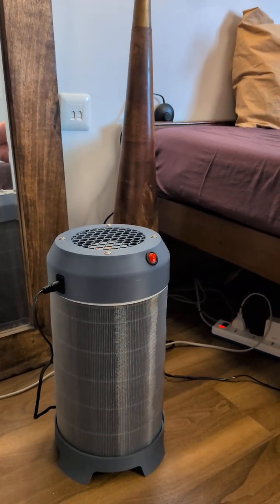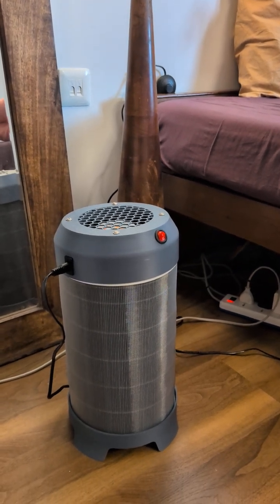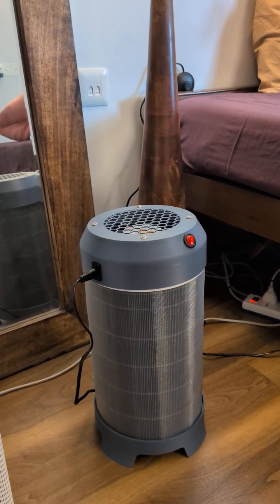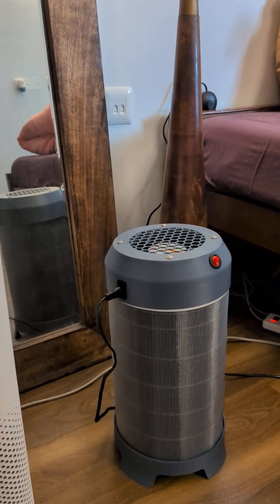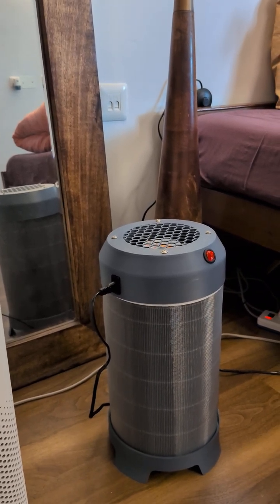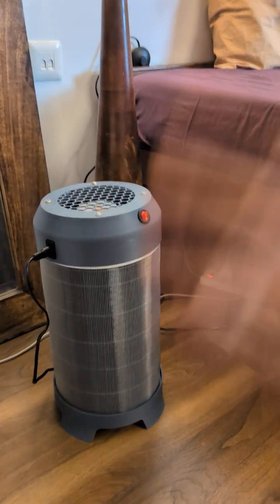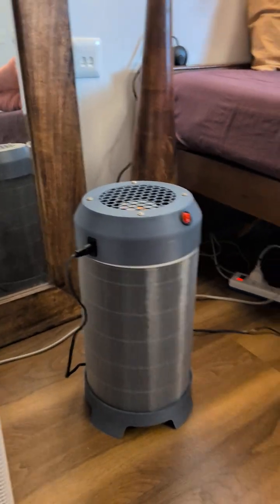I'm testing a DIY air purifier I bought from Jayant on Reddit — I'll add his bio to the link. It has a Xiaomi filter and a 3D printed canopy that helps it stand and look better than other DIY projects. It uses a static pressure fan, which is what you use in PCs — slightly different from exhaust fans. It's quite silent, and it's designed to suck more air, working better when there's a constriction like an air filter.